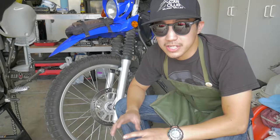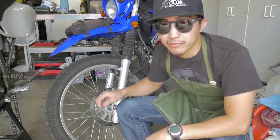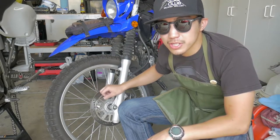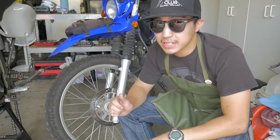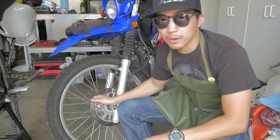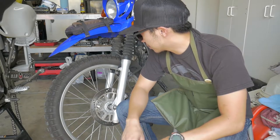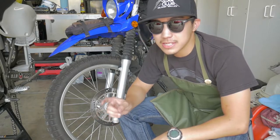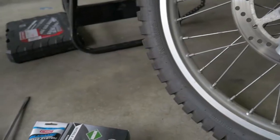My last couple of rides on these brake pads have been a little squishy, so I think it's going to be a problem we're going to find in the brake pads. You can actually see a little bit of damage on my rotors, meaning my pads have gotten down to pretty much their metal backing surfaces and they're starting to score my rotor. If you see any scoring on a rotor it might be a good idea to get a new rotor, but for now I'm just gonna replace my pads, and then replace my pads and my rotor at the same time sometime down the road.